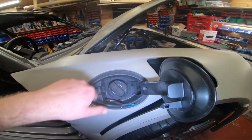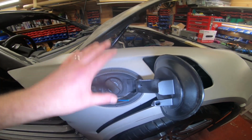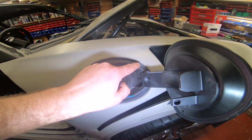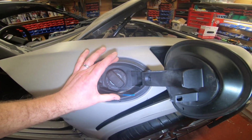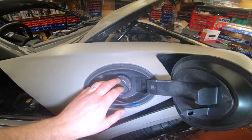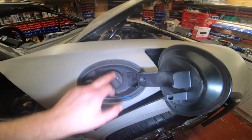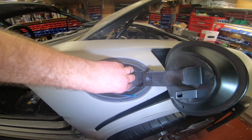You can certainly cut the big hole off the car. But once it's on the car, it's probably best to fine tune the hole. All I would say is, with the hole you cut out, take your time with it, because it needs to be quite big, but you don't want to go too wide. I can't really show you, but it's quite difficult to get this petrol flap cup in. You need some bit of a lip to rivet it to, and you can see how it is. It's just riveted top and bottom, so just drill a hole there, rivet, that's all you need, yeah.